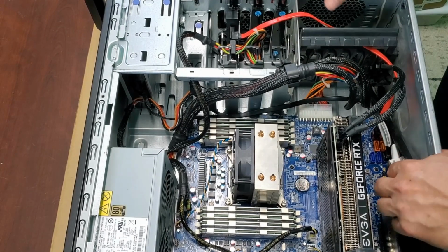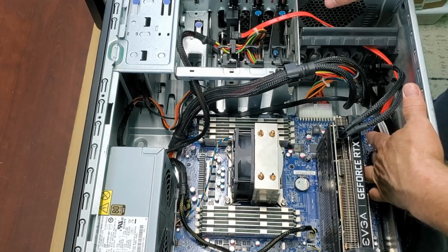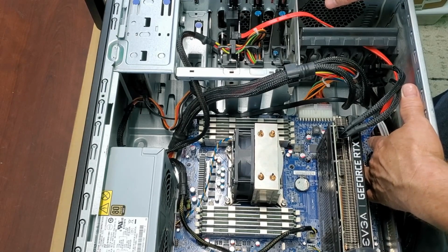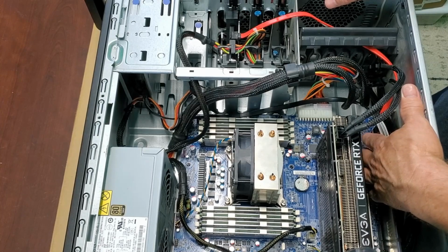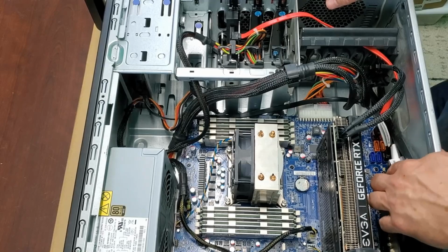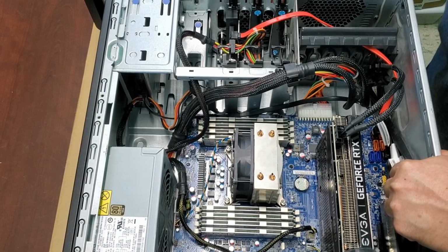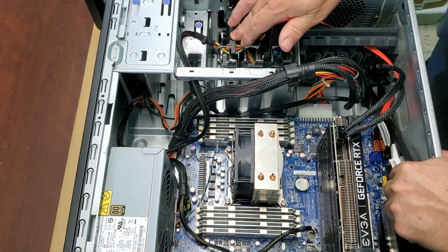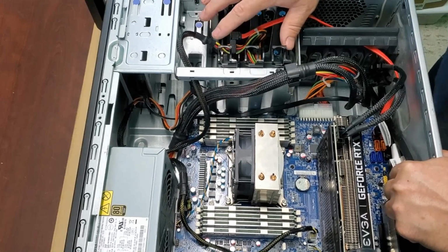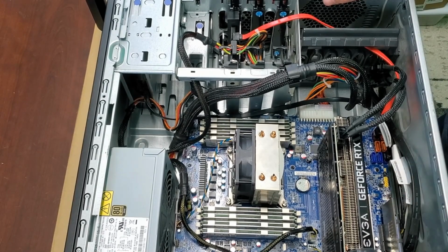If you're not going to use more ports, don't do it, because these blue ones, my understanding is they're the equivalent of a SATA 1. So if you're just using them for storage, it's not a big deal. But any drives that you need to really run a little faster, like if you're saving videos there and stuff, I would definitely plug those drives into the other ports. Don't plug them in the blue ones. Might not work very good.